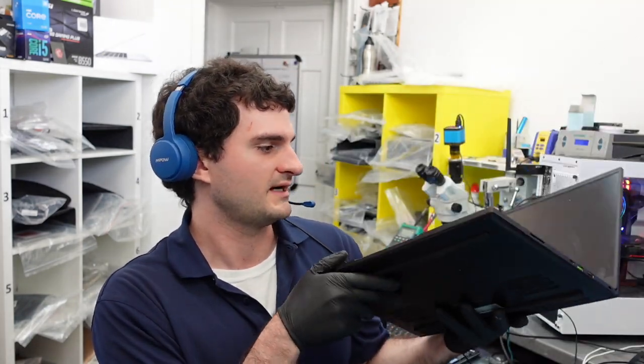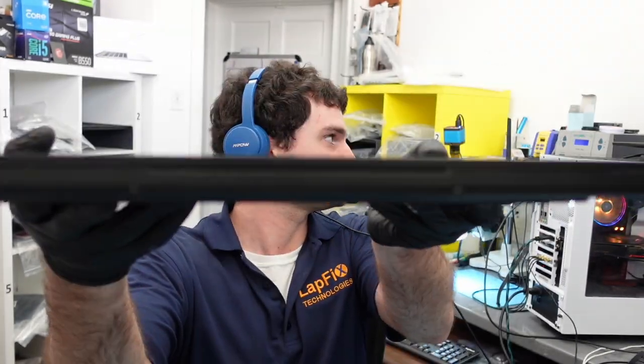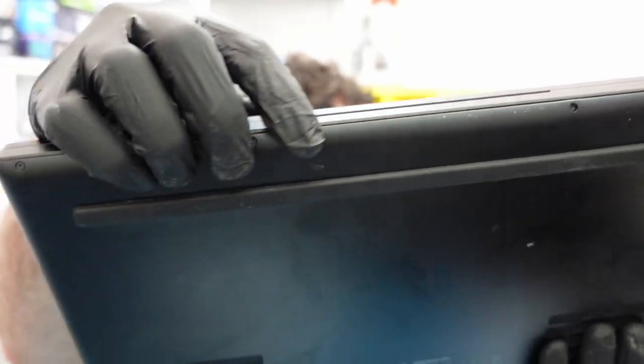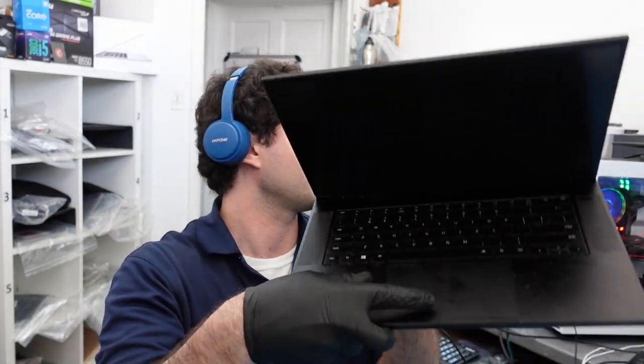This one's a little dirty at the moment, but it's in here for a reason — it is powering on and actually working. But if you look closely, you can see it's expanding. You can see the screw holes on the bottom are going in a bit. This laptop is actually expanding, and in all cases, that means the battery is expanding. It's getting worse and thicker, and it can actually damage the trackpad — we've seen it crack the trackpad before.